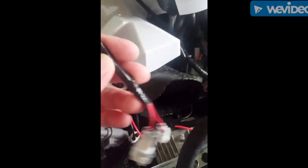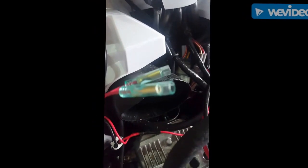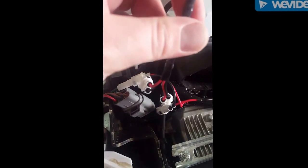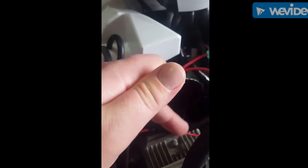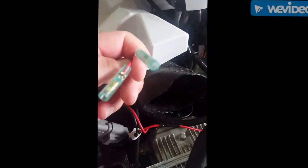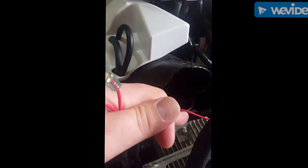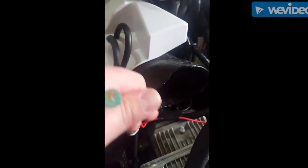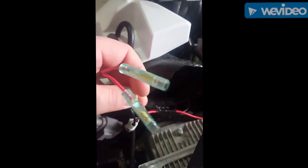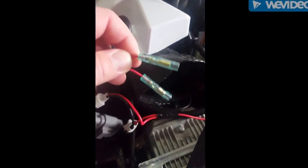But what Yamaha does is they give you this guy. So you get those two connections with two ends that look like that. They're both going to plug in here. These two, I'm going to take that, disconnect it. I'm going to snip this wire here. I'm going to add a connector that'll plug into here for both of these. One will be, this will be spliced right here. And I'll have one powering the winch and one powering the heated grips.